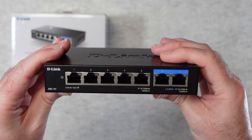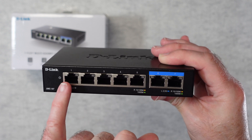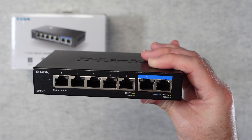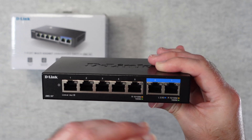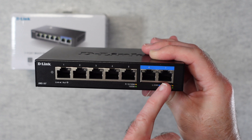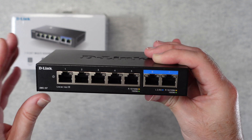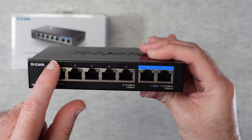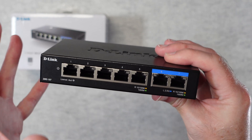The business end of the device has the model number in the bottom corner. We have a link port, five gigabit Ethernet sockets, and two 2.5G sockets as well. These are auto-sensing, so they detect the speed of the connected device and address it correctly. For example, if you were running another 2.5G switch you could connect in here for a really fast link between two switches, or connect individual devices for fast Ethernet speeds. The ports all have activity lights and link lights — a really nice array in a well-built unmanaged switch.